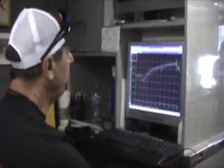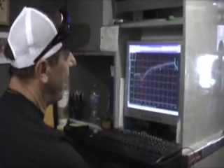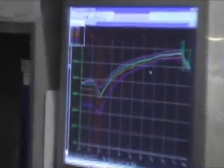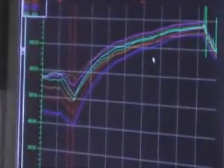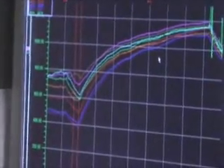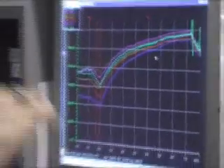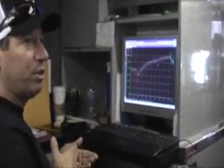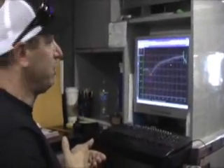Now you can see things in there like a miss, or like seeing this blue line here — number six is laying flat right there. That tells you it's a little too rich, which will correlate with the data you get from the air-fuel ratios. If the air-fuel ratio says it's rich, the EGT is also laying over. You can see detonation on an EGT, which is a little hard to see on an oxygen sensor.